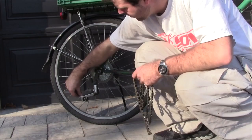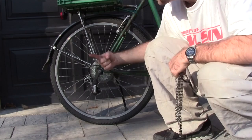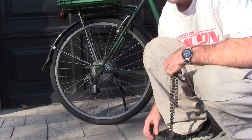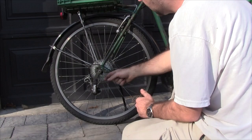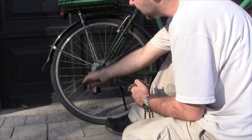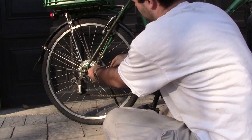Now that the chain is the right length, put it back on the bike and thread it through. Be careful when threading it through the derailleur — make sure you get it going through the right path through the gears. If you have it going through the wrong way, sometimes everything will seem right but it will make a funny noise because it's brushing up against something, meaning you went the wrong way around. You'll want to avoid that because it's going to do damage to your chain and your derailleur. Before doing this, I made sure to put the front derailleur on the smallest chain ring and the rear derailleur all the way in, because I want the chain to be the most slack when I put it back together — so the spring isn't fighting against me too much. Now I've got it threaded through, and you should just be able to push those two sections together.